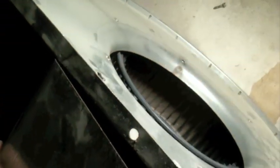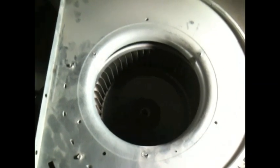So with the new blower wheel, with the nut on the left side, slip it down into your casing. And push this flap back into place, and put those two screws that you took out to allow this flap to come up, put those back in place. So with the assembly now in this position, you can put your motor back in.